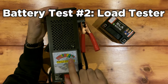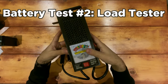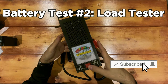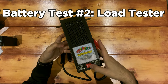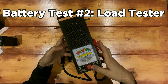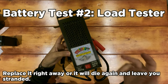After about 10 seconds it was touching yellow but still within green, so this battery is probably good. On the next battery, right away we know it's weak — it's been fully charged and it's still weak, that tells us everything we need to know. When I hit the button and put a load against it, the voltage drops right down to next to nothing. This battery is so in the red — obviously not to be saved, not to be trusted. You need to get rid of this battery right away.